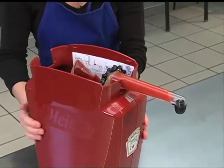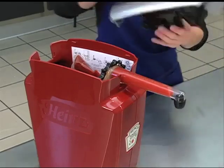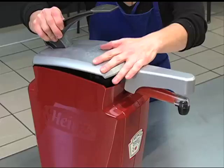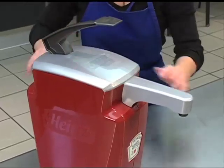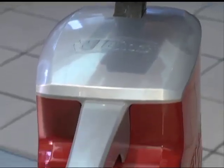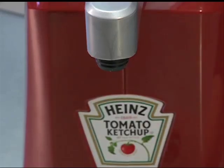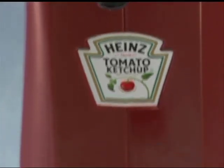The section of the bag that has the fitment should be at the bottom. With the handle of the lid in the up position, place the lid on the unit and push down until you hear a snapping sound. This sound indicates the lid is properly connected. To begin dispensing, press the handle several times until the product starts to dispense and is free of any air bubbles.